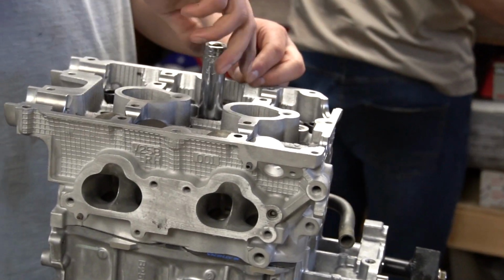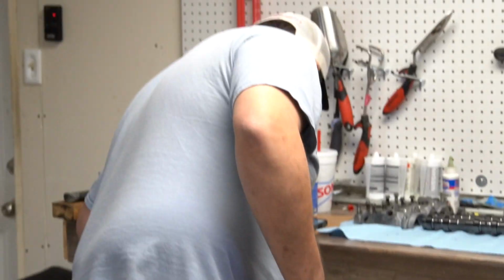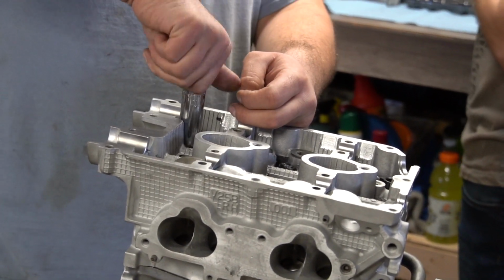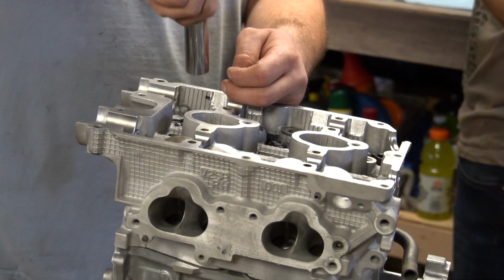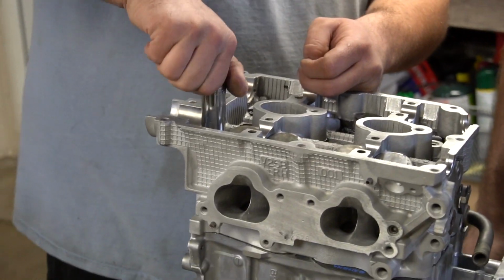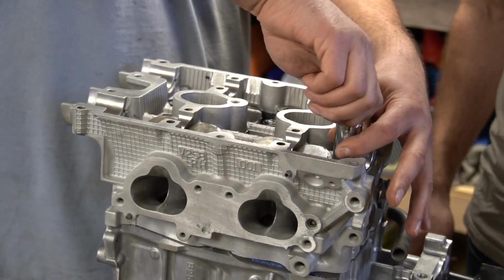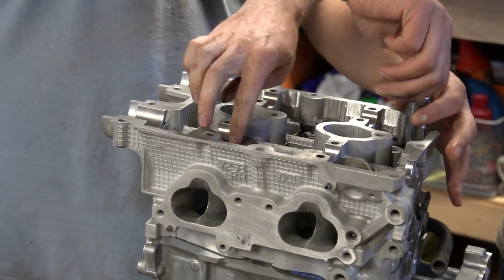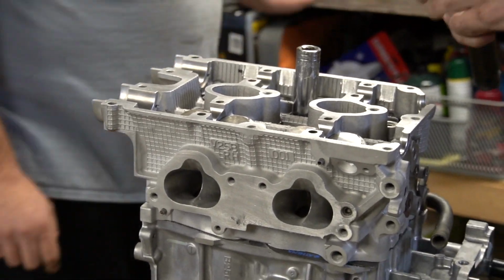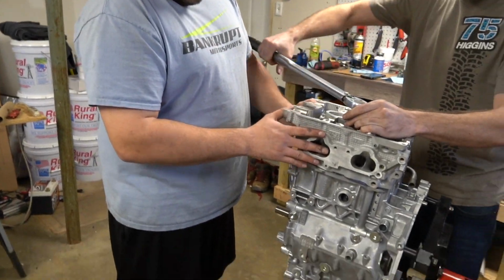Something like that. Is it torque wrench? Yeah. What's the first one? Center two at 35, outer four at 25. Buckets are new. Yeah, I got a lot of new ones in mine. Then measure them and do the one. Okay, so 35 center, 25 outer. Oh, you don't need to. Let's see. Yeah, that pin's not in it, so.